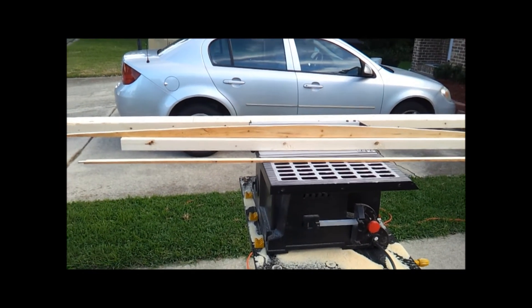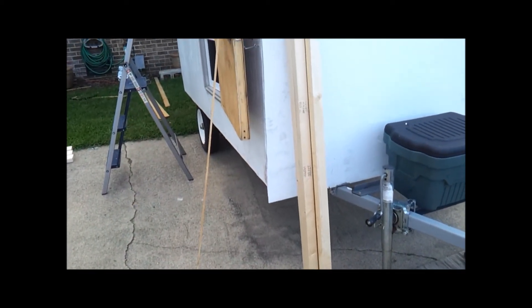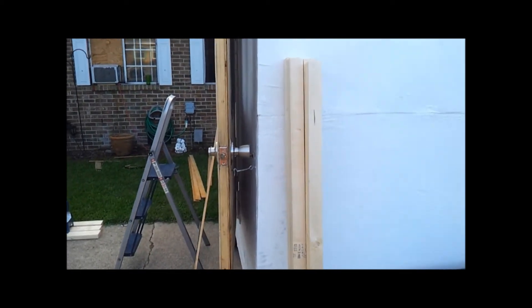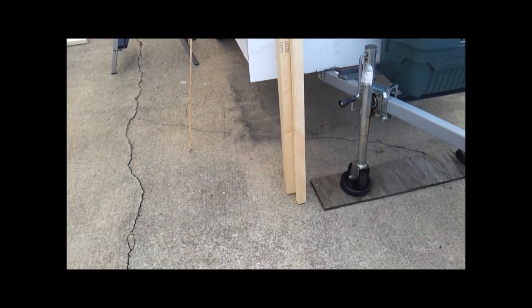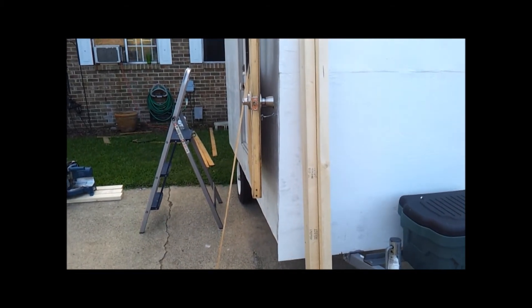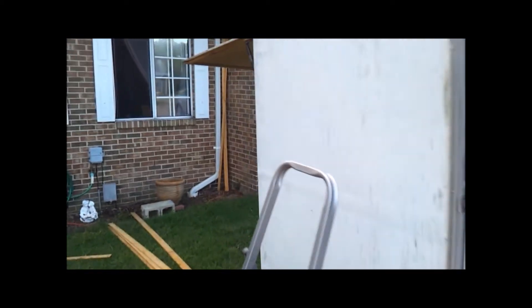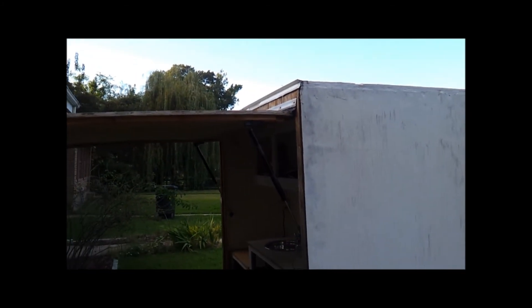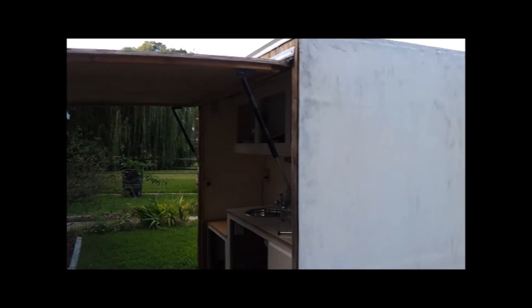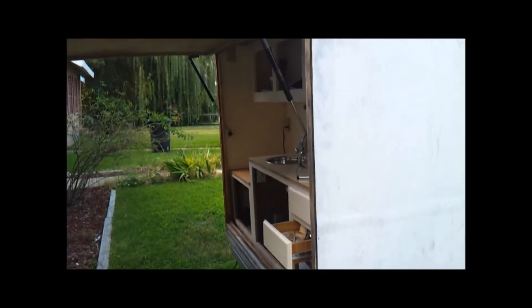Now I'm going to take that pattern and trace it on all six of my roof spars — my 2x4s that have been cut down to 62.5 inches — and then I'll be able to use those and put them together to give me a bowed roof. Plus, when I do the bow, I'm going to finish off the back end by adding 3 quarters of an inch to the back of the wood, and replacing the entire back area of wood so it's all nice and flat and everything will work properly.